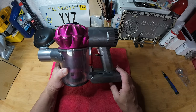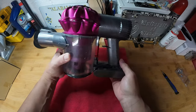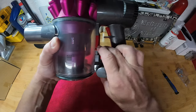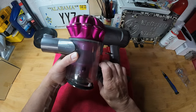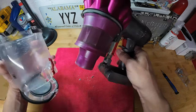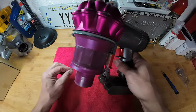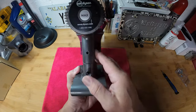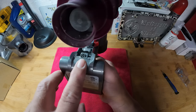When it comes to replacing the battery, you want to be sure that it is disconnected from the power where it would recharge. First, we're going to press this little button once and it'll open up the bin, then hit it again and that will unlock the bin so you can pull the bin right off — a little dirt came out because it's a used vacuum. Now you can see the two Phillips head screws: one is here and the other one is right there.